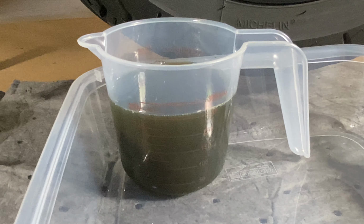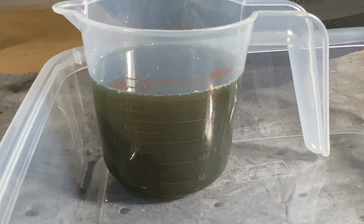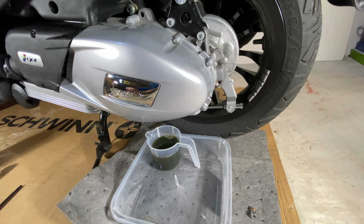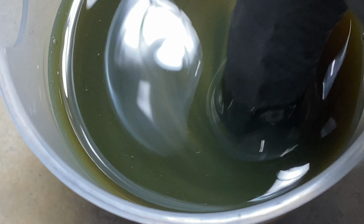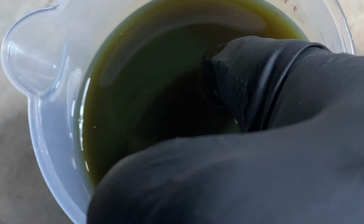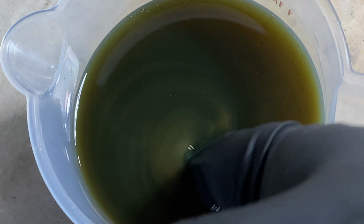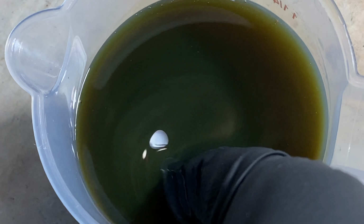Okay, that's pretty close to what 270 would be, because we're above 250 and you see the 275 line. So very, very close. I mean, it definitely wasn't low, so that's a good thing. Something that I would have wanted changed sooner than later. Maybe this lighting's a little better. That sheen, there is clearly some metal flake in here. So this is definitely something I think should have been changed at the 600-mile service, and I wouldn't want to wait with this until 6,200 miles.